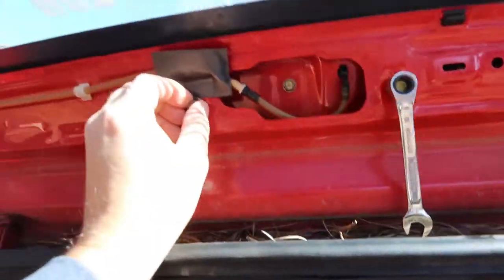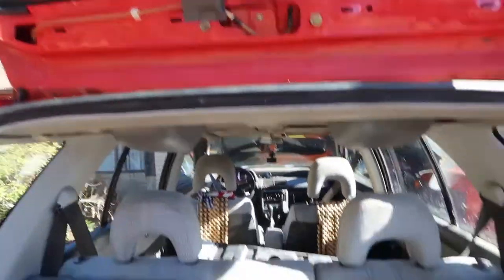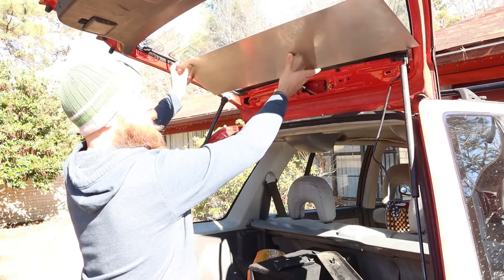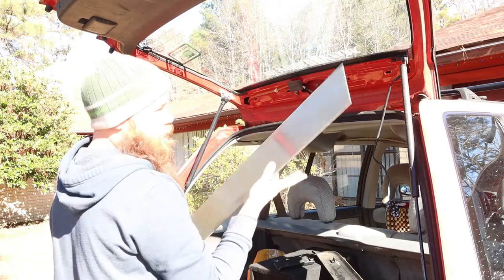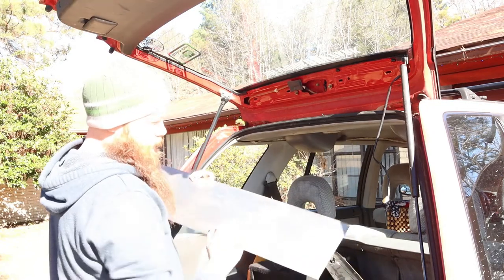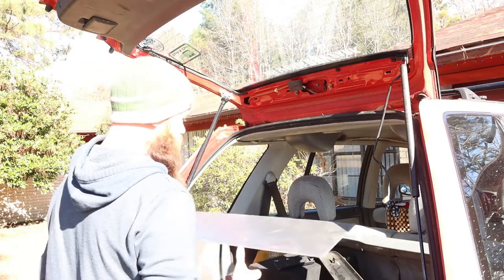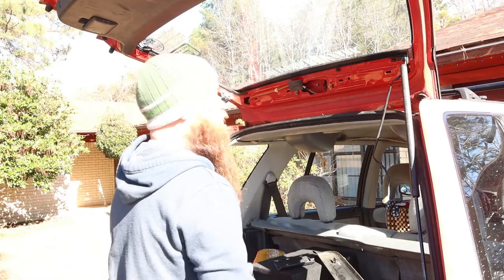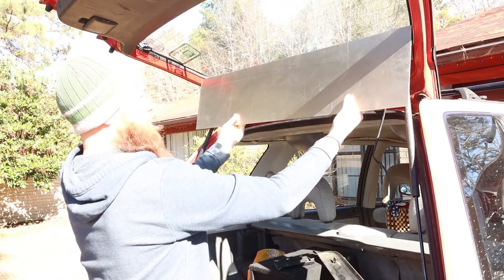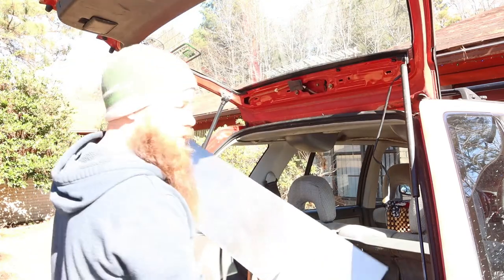I believe those 10-mil holes are actually a pretty good mounting spot for this light bar. Let me get this panel up here and see what we've got to work with. I want this to sit flush, or at least pretty flush up against the window here. This is just a piece of scrap metal I got from a yard — I just go to my local metal yard and see what they have laying around because you can get a pretty good deal. Got this piece of aluminum for 10 bucks. I'll make a full piece and it should be rigid enough for my lights. I need to figure out the width and how far it can go down before I run out of coverage — I don't want a rough edge hanging off the side.